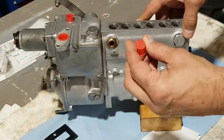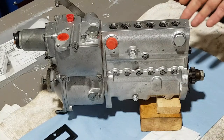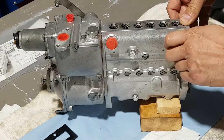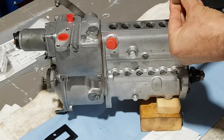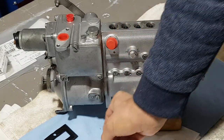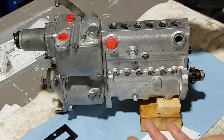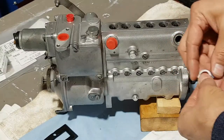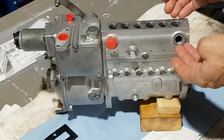Anyway, let's continue with this for now. We can just place a cup or something in it — one of those cover cups. They are cheap, I buy a bag full of them. Put this on — this way nothing gets in there, everything is safe and secure. I got those line cups at my local hydraulic supply place. They may not be the cheapest, but I think they are the safest way to protect the pump from any debris or anything getting in there.